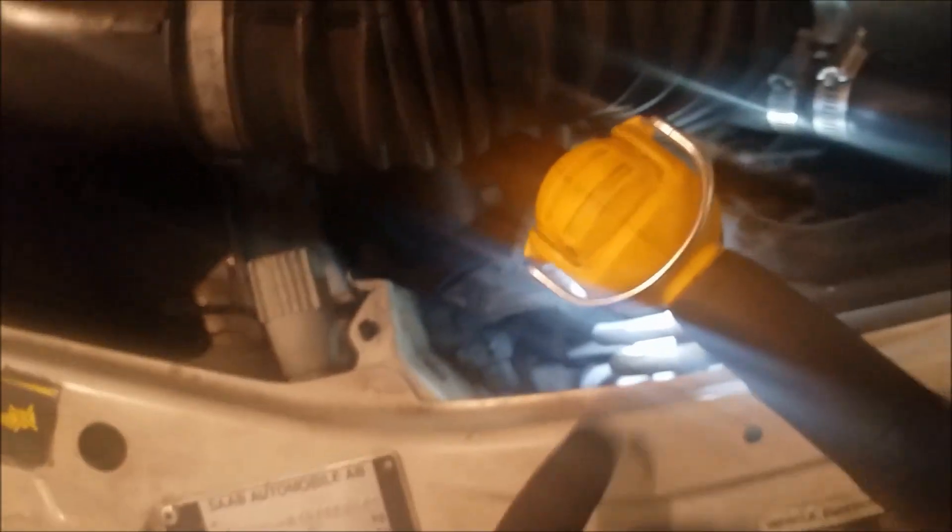Reinstall the retaining clip — hinges up. Reattach the plug; it just slides on. Most importantly, because I always forget this, the cover blends in with the engine bay. I used to always set it aside and then go to close the hood thinking I was all done, not realizing the cover was hiding somewhere. So do not forget to put this back on.